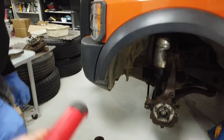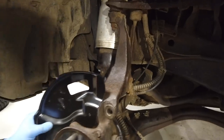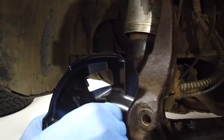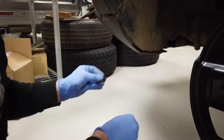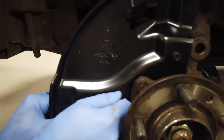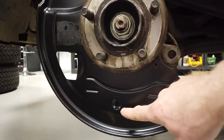Right, so here we go. We're at the hub. We've got our copper grease - you must have copper grease for this job. So we've laid the parts out. We're going to put the dust shield on first - that goes round the back of the hub, the bolts line up. Put one in to secure it and I'll go round with the copper grease. Grease it all up, because if you ever come to redo this you'll thank yourself. There are five of these bolts and they're all the same as when we took it off.